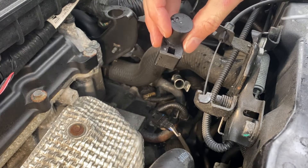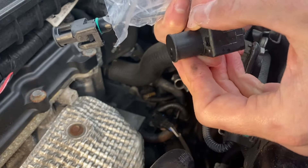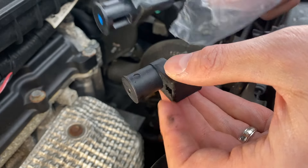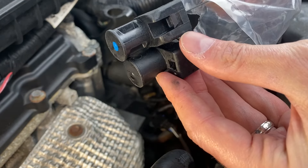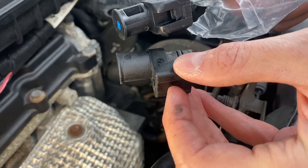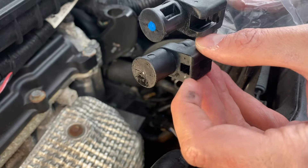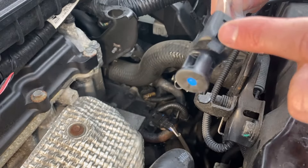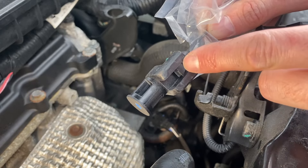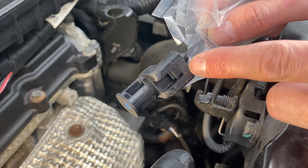So once more for the folks in the back — this actually did take me a while to figure out. We have our original cap here and the aftermarket cap there — both the same gaskets, same physical size. You'll see we have our cap and this fork mechanism here — it's just anti-repair. They clearly don't want you doing this service. We're inserting down this bit and working to catch the inner lock. Just use a small flathead screwdriver and you can eventually get to that.